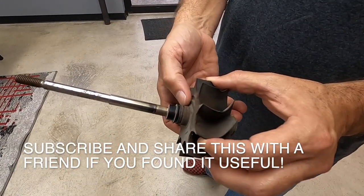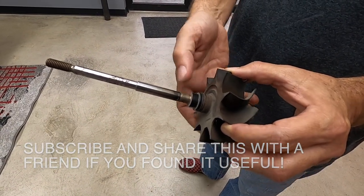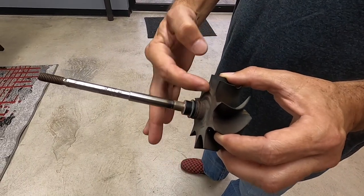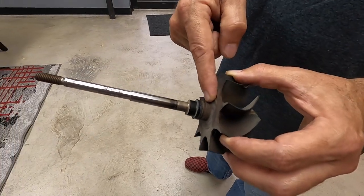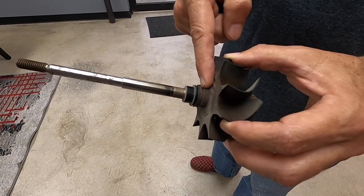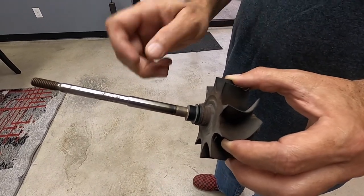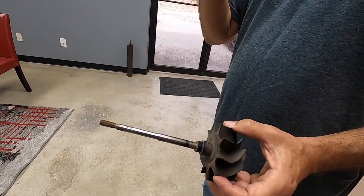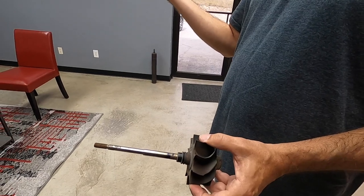This is where the piston ring sits. The moisture can't get very far that way, so the corrosion doesn't happen in there — but the bearing housing seal bore is right around where this is. So this shaft will rust, the piston ring ends up getting trapped in that rust as it expands in that groove and pinches the ring. Then when the shaft turns, it spins the ring with the shaft and it rips the bore out of the bearing housing. And that's when you go: wow, it was stuck for a while and now it's leaking really bad.